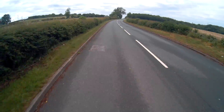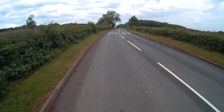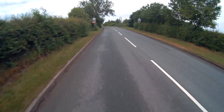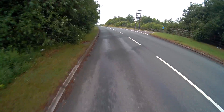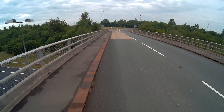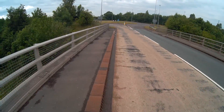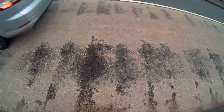Now this is quite a steep hill, so we'll maintain our speed of 15 and a half miles an hour. That's going to put a lot of strain on it and should get a bit of heat generation going. So now we'll pull up, put the e-brake on — which still needs raising even more. I think I've got it set to 40 amps now. And we'll check the motor temperature.